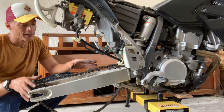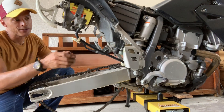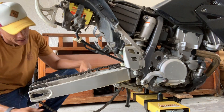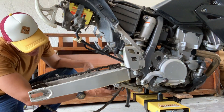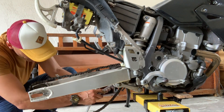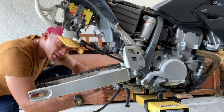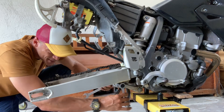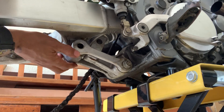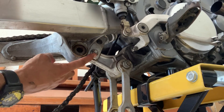With the rear wheel out of the way, you're now free to work. I hung up my rear brake — it's always a good idea to do that so it's not hanging by the weight on the hose and you don't stress out the fittings. Now we need to gain access to these dog bones right over here. We're going to loosen this 17, remove this pin, move those dog bones out of the way, and you now have access to your lower shock mount.